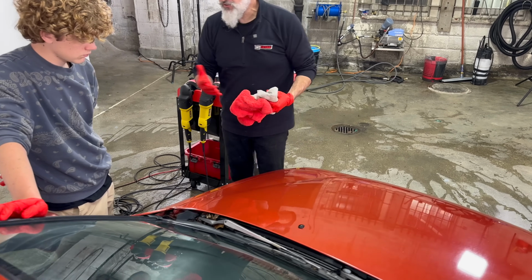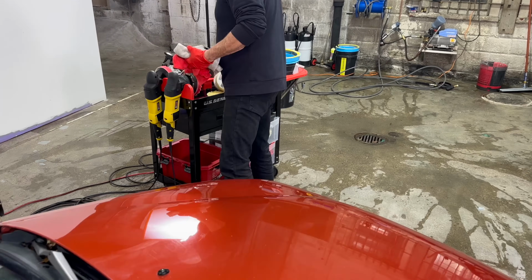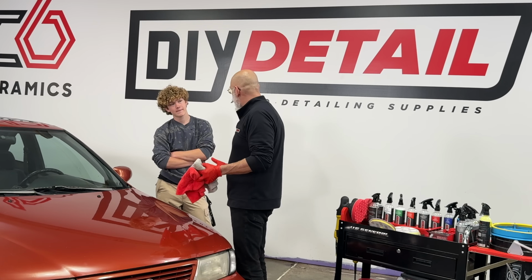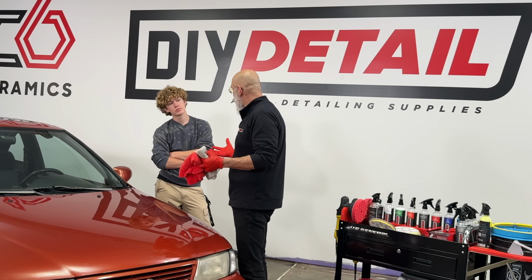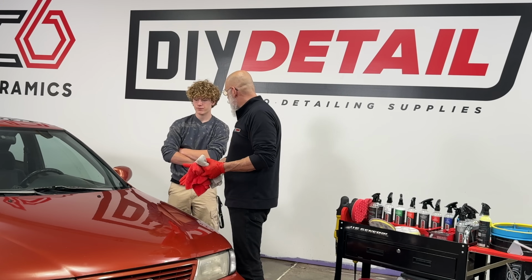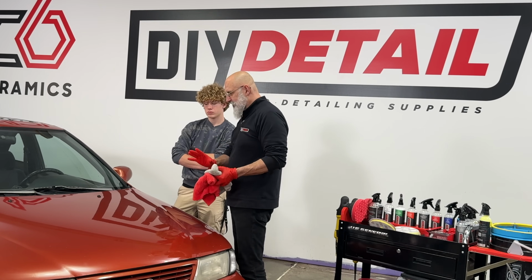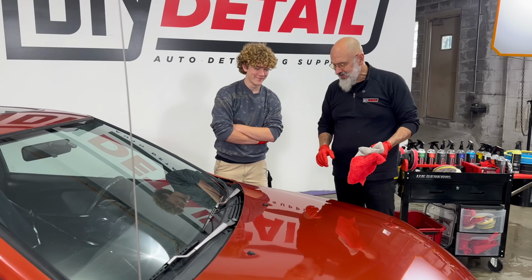Now, look right here, right? See what it looks like with an inspection light. So here we have polished, and we go over here, that's not polished. The results you got here with our finest pad, the one that does the least amount of work, you still got a nice gloss out of it, got rid of most of those swirls, and we didn't remove a lot of paint, which is important in your case. We don't want to remove a lot of paint.